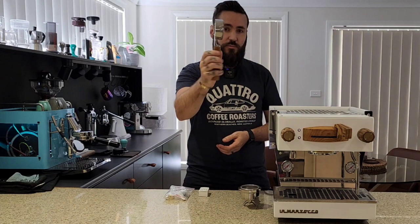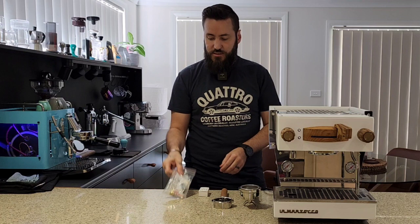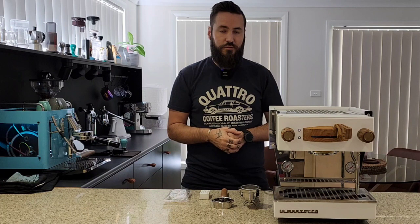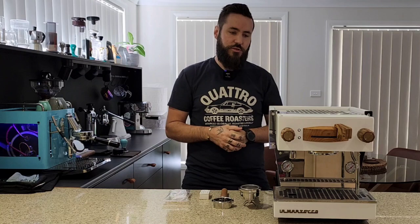This machine has had some pretty cool little things added to it, like the Weber UniFilter — great little product. We will be testing this. We're doing a basic annual service with all the valves and springs and steam wand, etc. We're adding a shot timer as well, simply because this machine doesn't have one. That's a little bit of an irk with La Marzocco for the price of the machine — it probably should have a shot timer in my opinion.